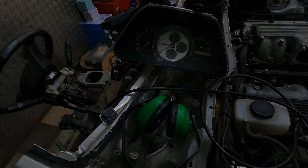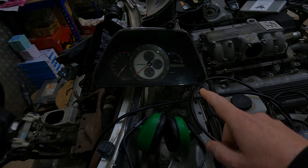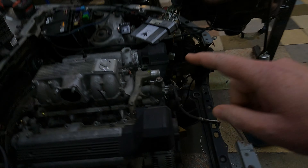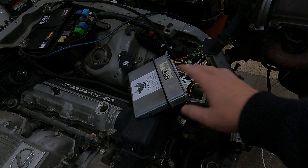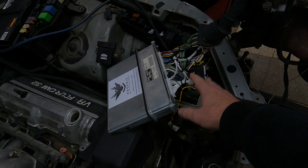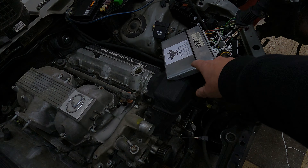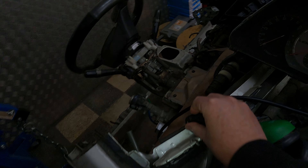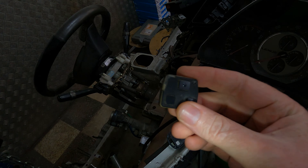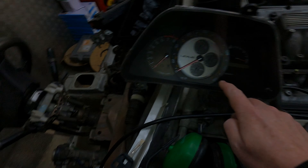Hello Amir. This is the update on your harness. Originally we did remove the immobilizer from the system, as yours is a GS430 and it communicates the exact same way as an IS200 or IS300. We've added in all the wires for the immobilizer side and reprogrammed your ECU to your key that you supplied — not your entire key, just the physical buttons on the inside where your ceramic chip is.